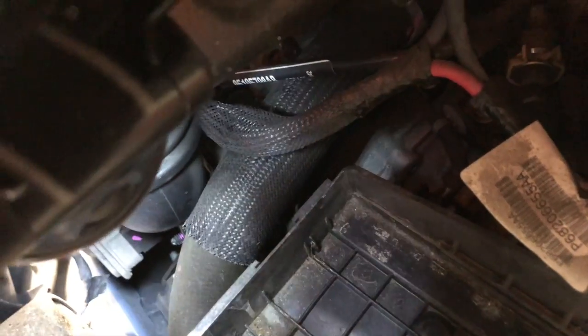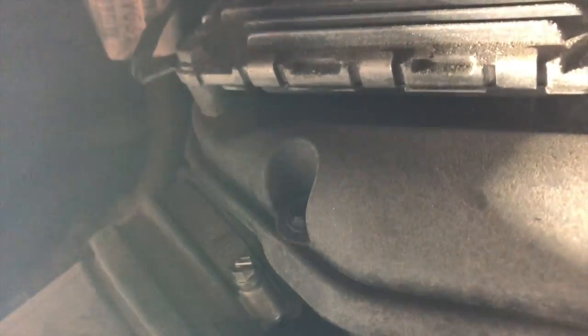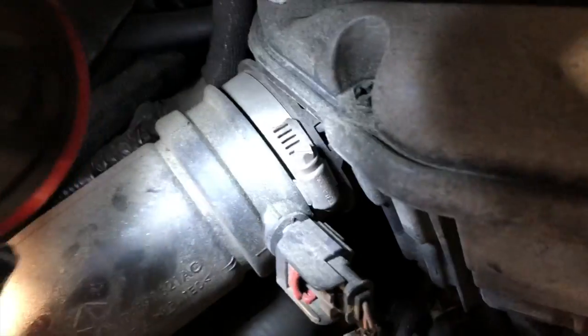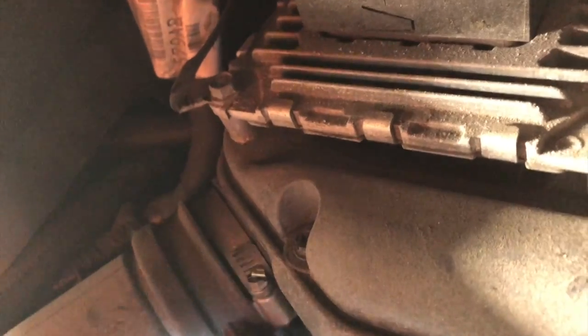Let's take a look down here. This air hose right here falls down into the throttle body - see where that elbow is? That's where the throttle body is, that's where I'm trying to get to. I'm going to go piece by piece and remove things. I'll start with the air box - I think just removing that should be enough, and I'll see if I have to remove the full thing or not.